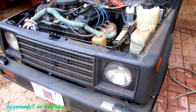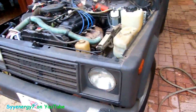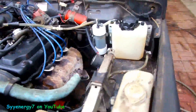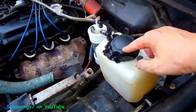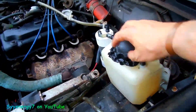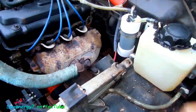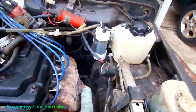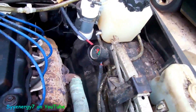After about two years, my HHO system in this little Suzuki SJ413 Jimny — basically a Samurai — has been trouble-free. The only thing I had to do was very minor: this gasket up here didn't seal quite perfect, so I just put a couple pieces of very heavy trash can liner under there to shore up the gasket. You can see the production — it's not drawing many amps because that's how I have it set, but that's enough to give you a little more mileage when you crank it up.